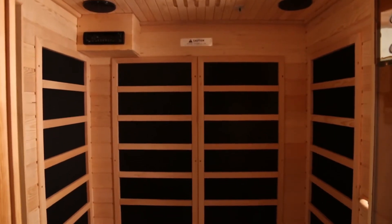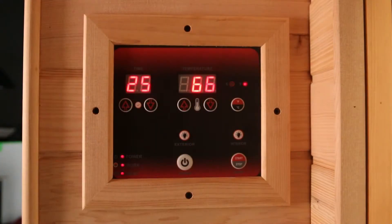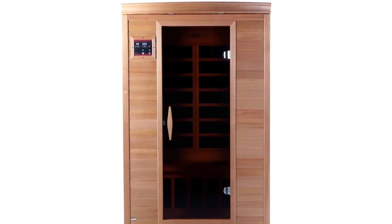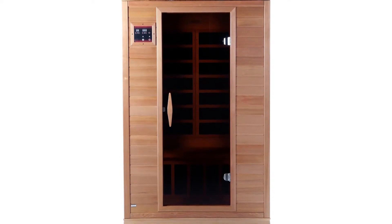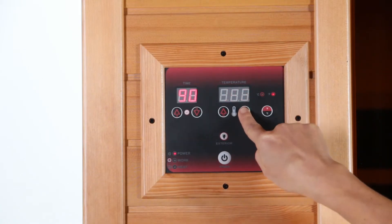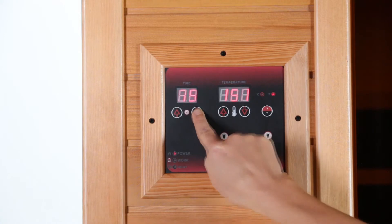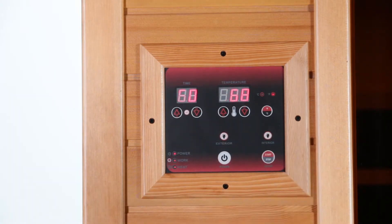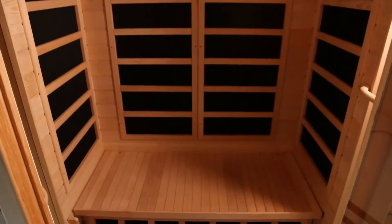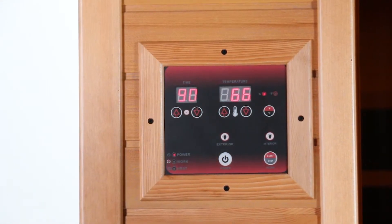Once you press the start button, the heat emitter panels will start generating heat, and the sauna room will slowly warm up to your desired temperature. Remember that opening the sauna door before it has reached the desired temperature may prolong the time needed, just like opening an oven door while preheating. Five minutes before the set session time is over, the buzzer will sound for approximately 15 seconds to warn you. At that time, you can allow the time to run out, or adjust the time remaining by pressing the temp button and then the up or down arrow. When resetting the timer, the control panel will flash and heat emitters will stop generating heat. When finished adjusting, press the start button twice. If you do not press the start button twice within five seconds, the control panel will revert to its previous settings.